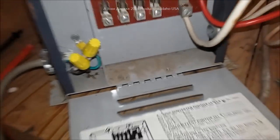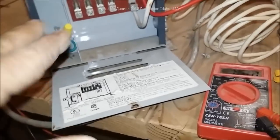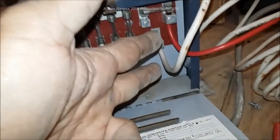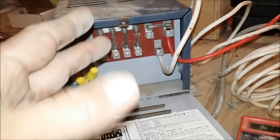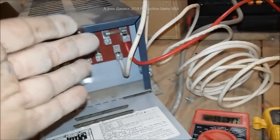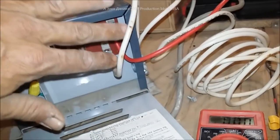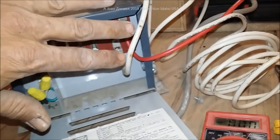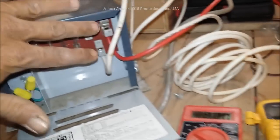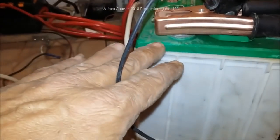This also just goes straight to your battery and feeds power back to your circuits when you're not plugged in. In this one's case it needed a rectifier, so we replaced it. When you read that voltage and get an unrealistic reading — if it's zero volts it's bad, but if it's showing four or more volts it's actually good, it's just waiting to be connected to a battery.